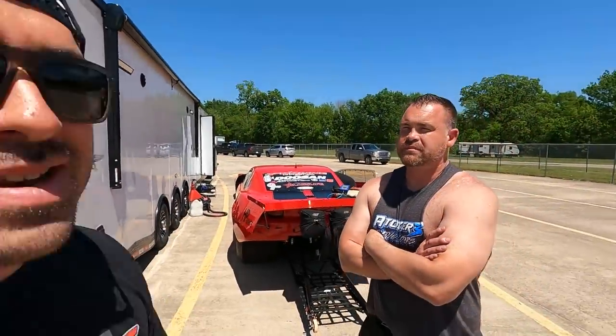I'm out here with Ryan for the purpose of taking new photos of the new setup you got going on, right? What have you guys done that's different from the turbo setup you had in the red car? You know, when I got this car, 6, 7, 8 years ago, this car was a purpose-built 10.5 car. And being that it was a purpose-built 10.5 car, it had the motor really far forward in the chassis. That's good for 10.5 stuff. You want 57, 58% on the nose. Some guys are running even a little bit heavier.